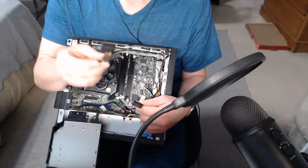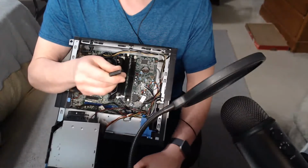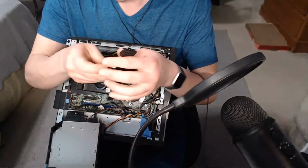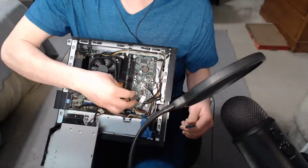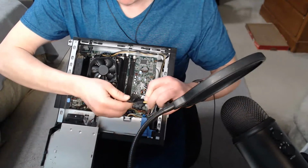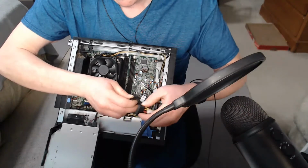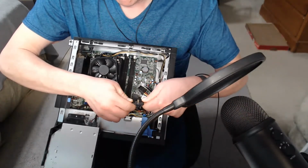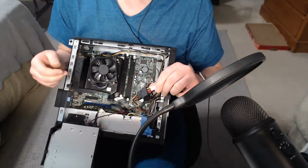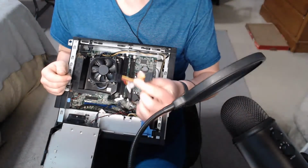Well, ta-da, that's where this baby comes in. A lot of you may not be aware of the existence of this, but this is basically a duplexing connector. So what you do is you plug in your one lowly SATA power cable into this one right here, and I got to get the right one. I got to get the male. So I'm going to plug this in, making sure I match it up properly, just like that. And voila, you actually have your 2 SATA power ports.